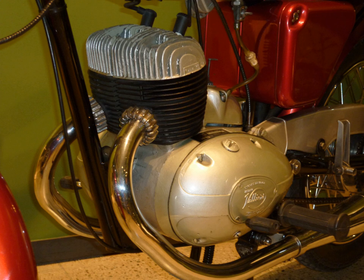A feature of the 270-degree parallel twin is that it provides most of the feel of the popular V-twin layout, along with further advantages. It is simpler and cheaper both to produce and to maintain, needing only a single cylinder block and head. Air filtration, fuel induction, exhaust and cooling are simpler. The engine is lighter and has better potential for an optimum center of gravity position. Battery location is easier, rear suspension design is simpler, and it allows a shorter wheelbase for sharper handling.